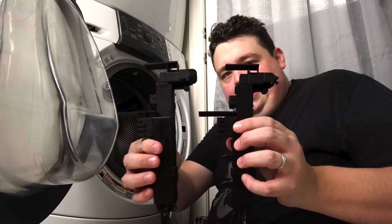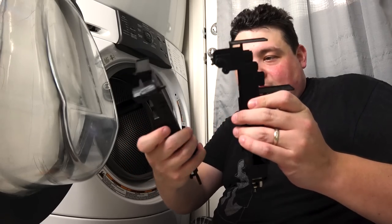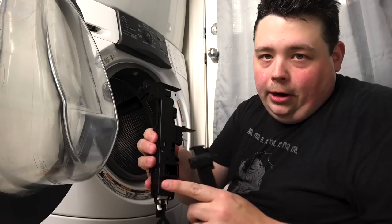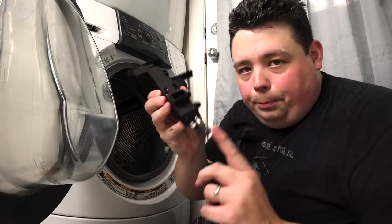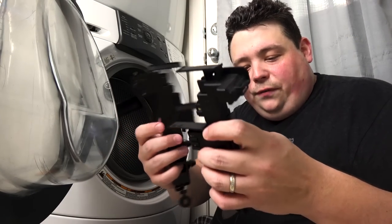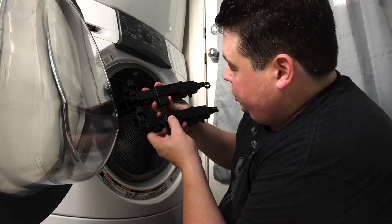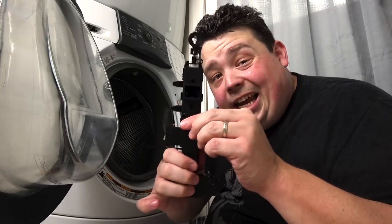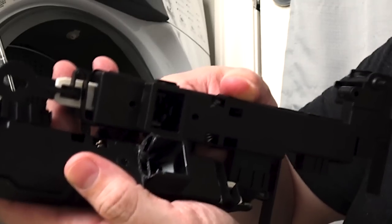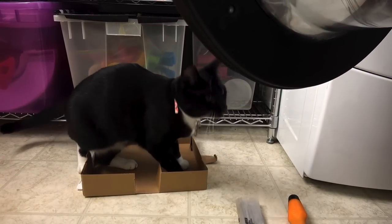Here's the new part I ordered off Amazon — cost me about $40. Let's put them side by side. They look absolutely identical down to every single detail except one: the new part is a little thicker around the door area — probably because that was the part that failed most — and the little piece at the bottom where the screw goes through is a lot thicker too. One ends in part number 0692 and the other ends in 0691, so this is clearly one revision newer. They made the mouth area and the mounting eye beefier because it tends to break — and that's exactly what broke on mine.